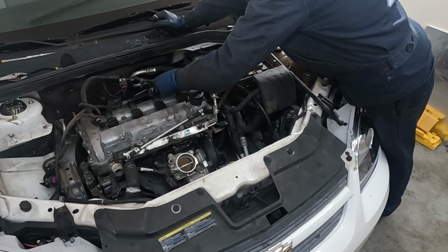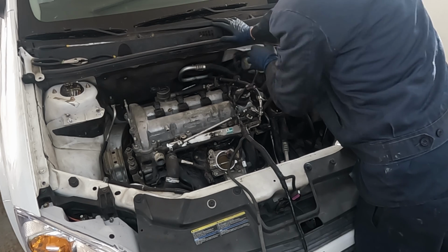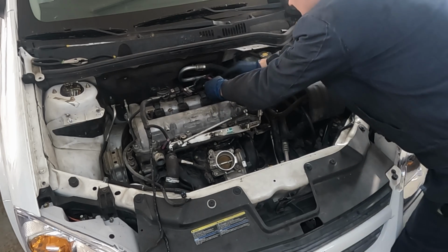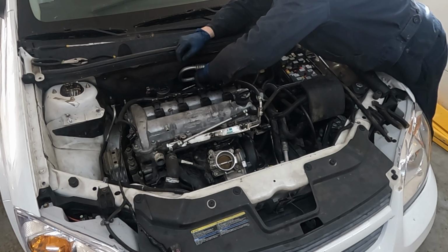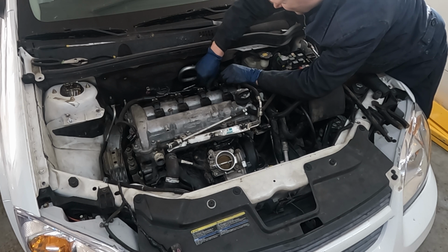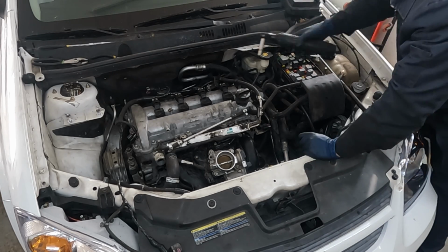Can put these on. You know, let me tape up this harness. It's looking pretty raggedy. Okay, so I had to remove that ground strap in the back up top here just to reposition it so I can get more room on my harness here. So we can plug these in. There we go. This long one goes down the back, all the way down. Still not sure if this goes in the front or in the back. Oh yeah, that's better. If your wiring feels not right, like it's crumpled up or cramped or pinched or whatever, go ahead, move it around, get it just right. We want to make sure our routing is good for our wires.